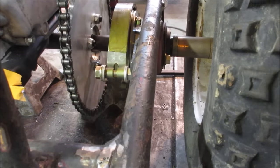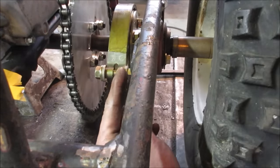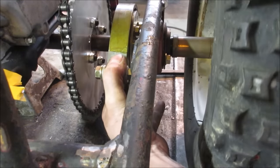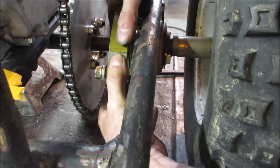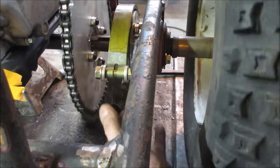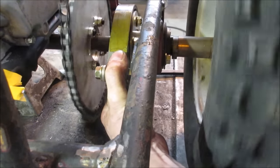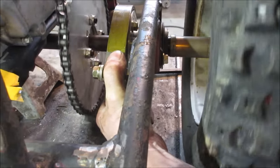So I was looking at the brake setup. I think I have it backwards. I copied off of what they had, but I think it's wrong. They had the collar going around and then pulling on the bottom. The cable would go through here and pull up on the bottom half of it. So if it's spinning this way, it's fighting itself. It'll work, but you're losing a lot of power. I'll run it backwards to give you the same idea. See how it's dragging? It's pulling the brake band down, and it works much better than when I go this way. See, I'm not changing the tension. The wheel's much easier to turn this way, a lot harder to turn this way.